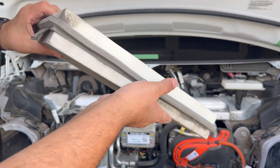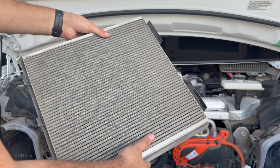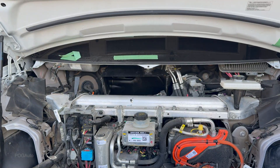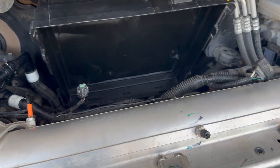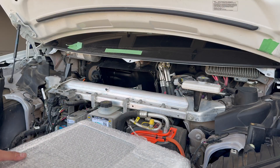The arrows point towards the inside of the car, and there are also clips so you can't really install it wrong. Look how dirty this HEPA filter is after three years and 86,000 kilometers here in Calgary, Alberta — we get crazy winters and smoky conditions. Here's the inside part of the filter — it's not that dirty, but the outside is crazy dirty. I'm going to take a vacuum and clean around this vent area, then put everything back together. The inside is nice and clean.